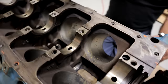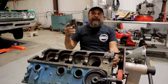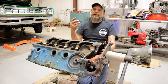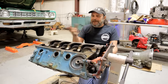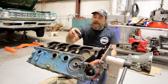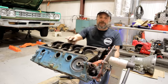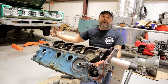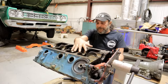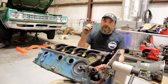You can have an engine that overheated badly, got into heavy detonation, and cracked in that area — but because it's just used for regular service, it won't show itself as a problem. But now you step on this thing and that crack is going to spread, and it's going to want to throw the crankshaft on the ground. In extreme cases it'll split the block right in half. These areas right here are definitely your number one focus area for looking for any type of cracks or imperfections.